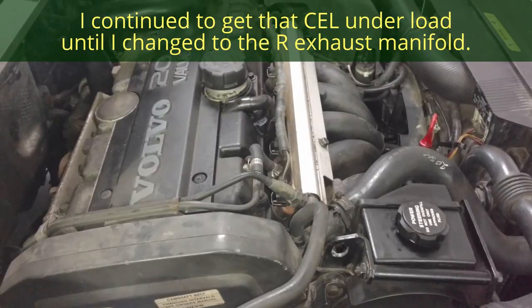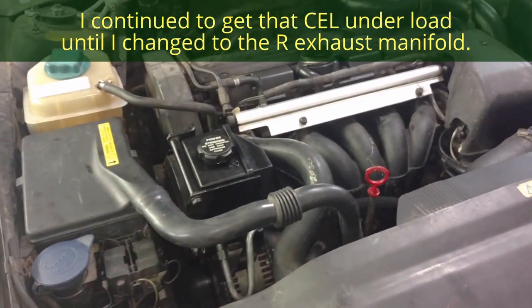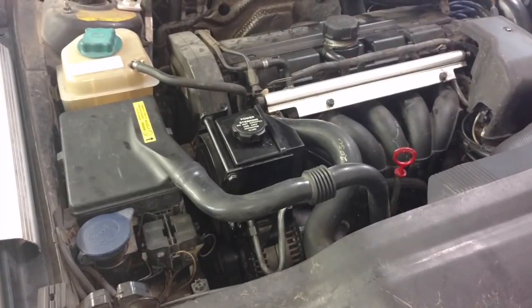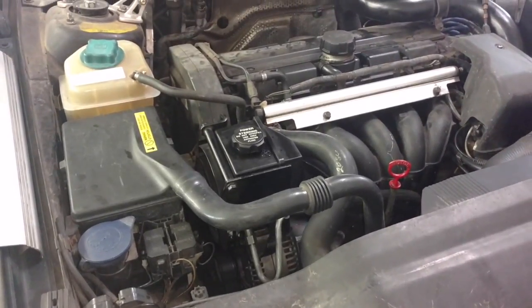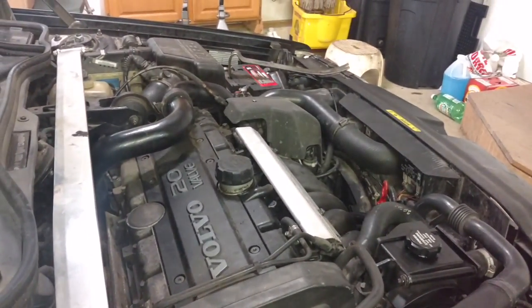If I didn't have white or blue injectors, I would need to run my original ECU until I got said injectors, because it's just not good running these old injectors with the 98 tune. Now we have the blue injectors installed. We should have no fuel mix problems, and I will run rich rather than lean. Lean burns valves, rich burns gas.